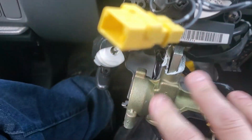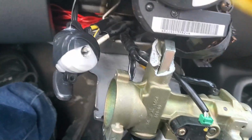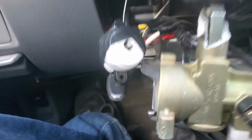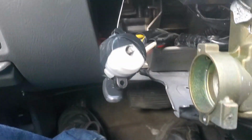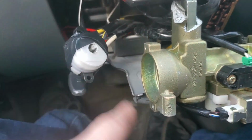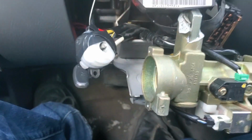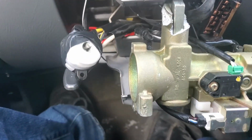So they kind of did their thing here. Then when I got back from impound, fun times, I had to stick my key into here, turn that, and that's what would actually start the car. So this is neat for someone who doesn't know, I guess. News to me, this, on the back side, the wires that are soldered on, shorted out against this mangled piece of metal, which exploded the main fuses, which are located in the engine bay, if you are curious. 40 amp fuse, mini stud. Ask me how I know.